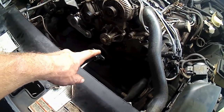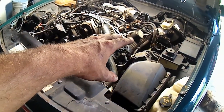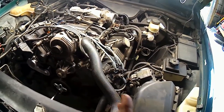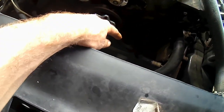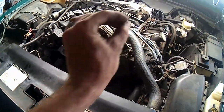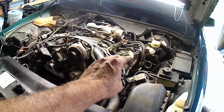the engine over backwards. So, what I did, if you're not familiar, on the back side of these 4.6s, well, it's the back end of the motor, there's a little rubber cover. You might be able to see it down there. It's pretty dark. But there's a little rubber cover. There should be. Yours may be missing. And you can pop that out of the way, and it is there to access the torque converter bolts at